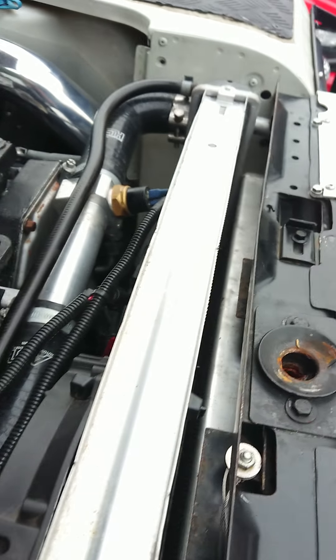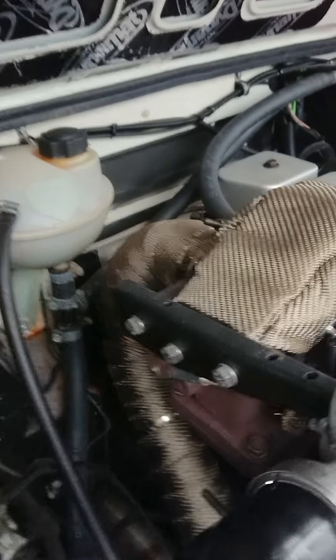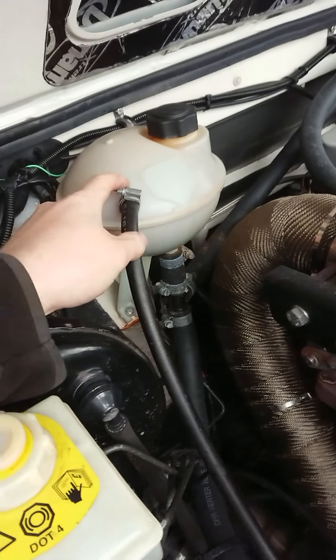And pipe it into the bottom of the radiator. The top hose is fairly straightforward — there's a temperature sensor in there to turn the fans on and off. The header tank is basically mounted over there. The pipe runs all the way down to the bottom for filling up. There's a breather hose on the top of the TD5 radiator which runs across and back up into here.